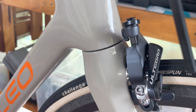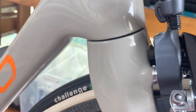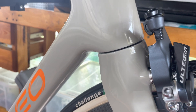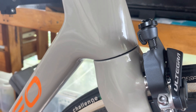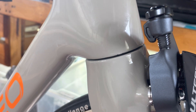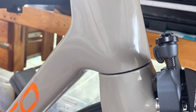That gap is now about one millimeter. It was about two millimeters and it didn't look beautiful — this looks normal. It's an aesthetic consideration; it was functioning fine, but when I put the fork in I noticed that gap and thought that doesn't look good. Then I saw Cycling Milan's video on YouTube and he had the same issue when he was building the Yoleo R12. He noted that the bottom bearing in the head tube is eight millimeters tall, the bearing at the top is seven, so he just switched that out for a seven millimeter down here and it reduced the gap.